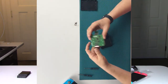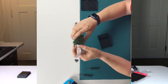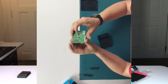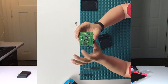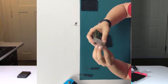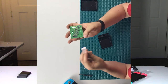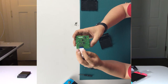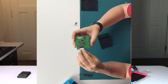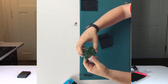First, flip the top side over — the Switch is going to sit in it like this. If you haven't connected your ribbon cable yet, there's a little lever on the connector: lift that up, then insert the ribbon cable — one side is blue and the other has the copper connections. Make sure the blue side is facing up, slip it into the connector, and you'll know it's seated properly because you won't be able to pull it back out. Then simply press down on the lever to lock it.